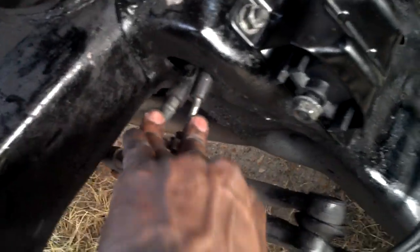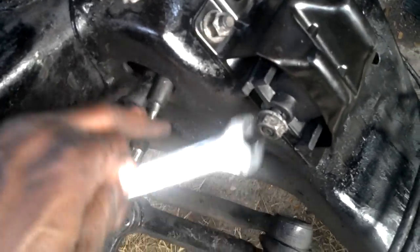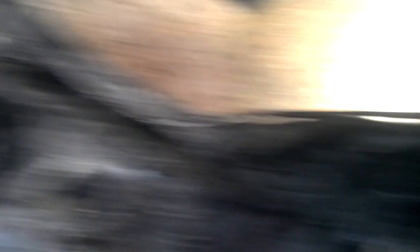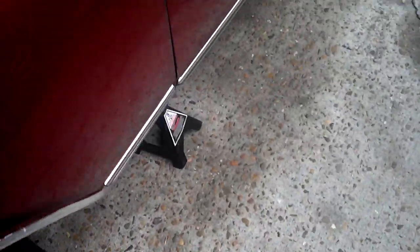Because of the fuel lines on this side, you do the same thing — move them out of the way, stick your wrench in there and hold it. Now you got the bottom ones right down there. That's your easy way to do that three-to-four hour job.